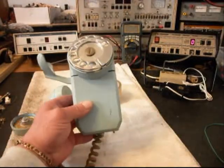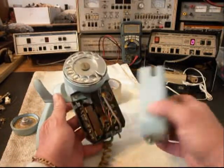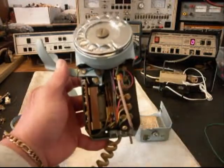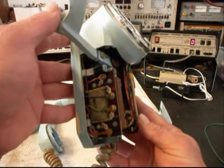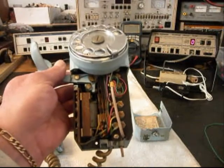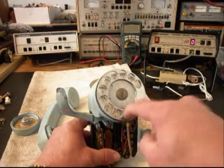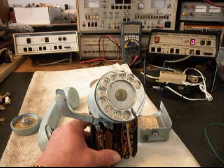It's in the Art Deco style, and this is a metal body. We have the cover loose so we want to show you the inside. We have a schematic, and if you've never seen the inside of one of these telephones, that gives you an idea of what they look like. And then the rotary — we also want to go through the rotary. It's sluggish and it's going to need to be oiled, cleaned, and adjusted.